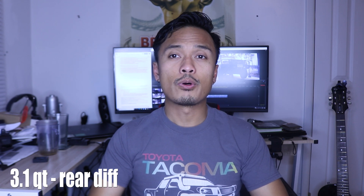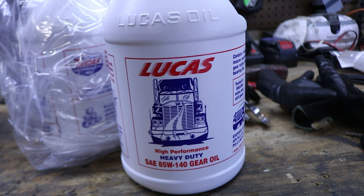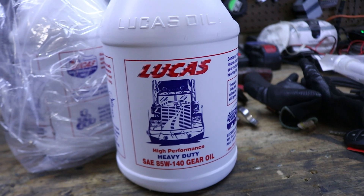The totals are 1.6 quarts for the front and 3.1 quarts for the rear. Upon actually doing this job, I discovered that the front lockers and rear lockers also take up extra room, so you actually use up less lubricant — roughly about 1 gallon in total instead of the 4.7 quarts. Now there are proper guidelines to break in these new gears, detailed at East Coast Gear Supply's website. The first thing on their guideline is to use Lucas 85W140 non-synthetic gear oil — the link is on my Amazon page at amazon.kflow-crib.com.